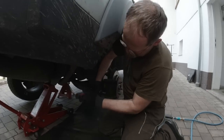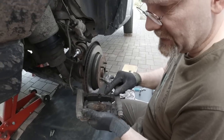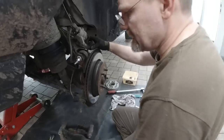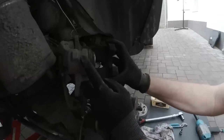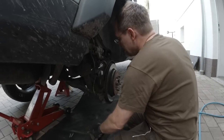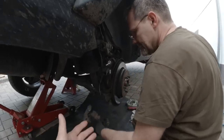I still need to get another battery. Now you don't want to replace your brake pads at the last minute. You can see how they still got almost a quarter of an inch. This one maybe 5mm. Your brake caliper is just moving out further and further, and it will make this brake cylinder lock up prematurely. You may as well do it a little earlier, and that will prolong the life of your brake caliper. Ah, to me they look brand new.